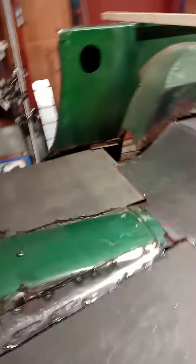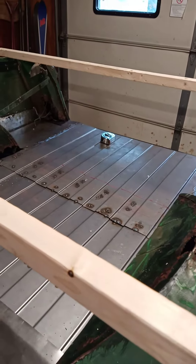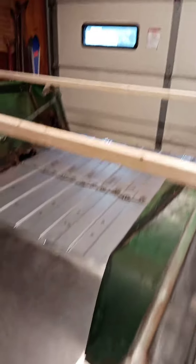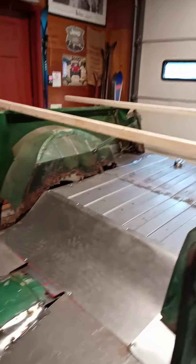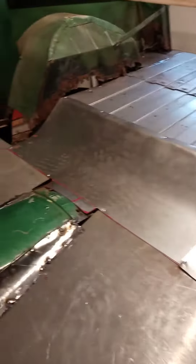What I got accomplished the last two days, eight hours each day: I got the floor pans put in, welded, sealed up. I got the rear cargo area pans done — they're all welded and painted underneath. And then I decided to get the side quarter panels put on. Got them in place, all leveled, ready to go.